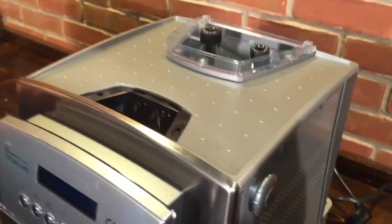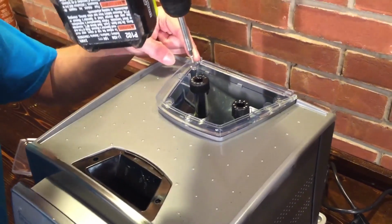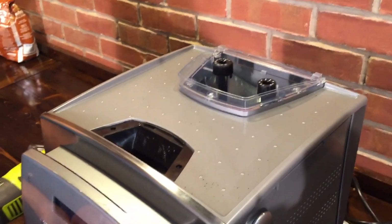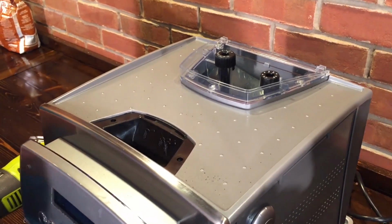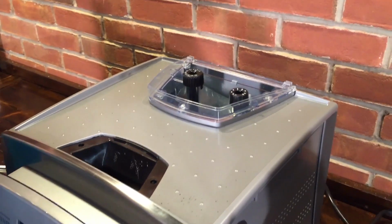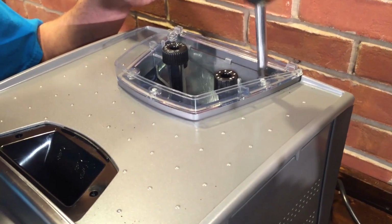There's a lot of torque on those. Just turn it until it stops. It's just made to hold the hopper in place, and the holes that the screws go into are kind of like a fiberglass material or plastic or something. If you continue to try to force it into that hole, it'll chew it up and make it bad. And if you get all three of them like that, the hopper will just pull right out with the screws still in it. So be gentle replacing these ones.